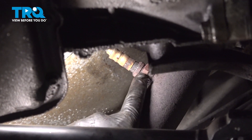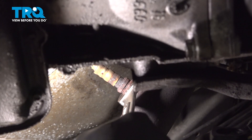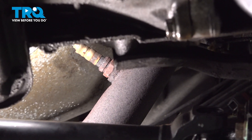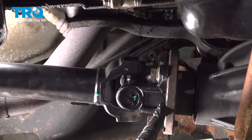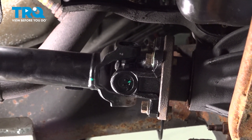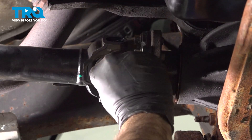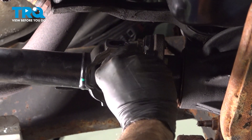Now gaining access to the upper O2 sensor, I'm going to use a 22mm wrench. Going between the drive shaft and the transmission, there's really no room to loosen that. So what we're going to do is loosen and remove the four bolts holding our front drive shaft to the differential flange and swing that off to the side so we can access that O2 sensor. Before we unbolt the drive shaft, I'm going to take a crayon and mark one ear because we want this to line up in the same exact position when we reinstall it.